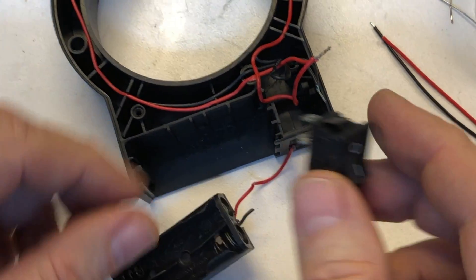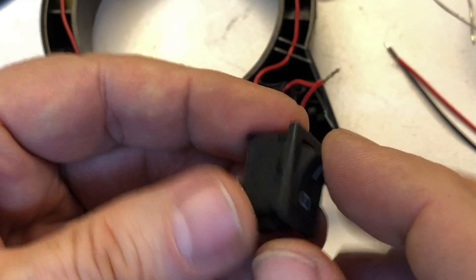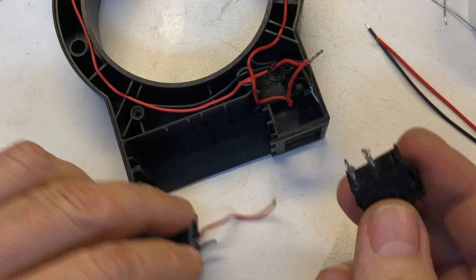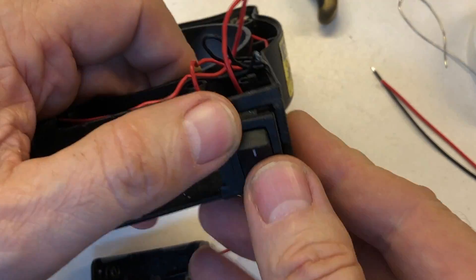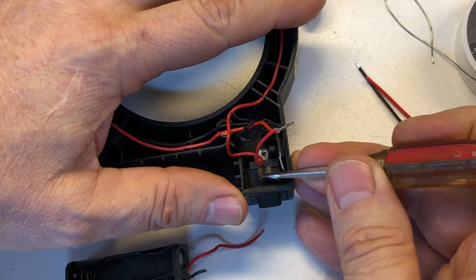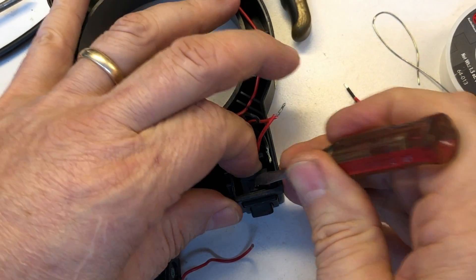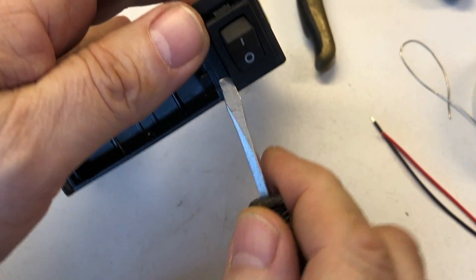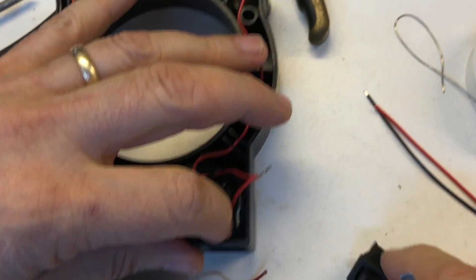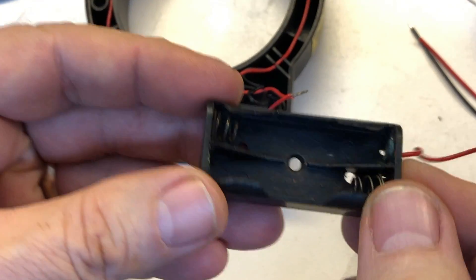In popping the switch out I found it also had corrosion wicked inside of it. I got an ohmmeter out and the switch is dead too — so that can happen. Let me show you this piece. To get this switch out, get a flathead screwdriver and press down on the tab on the top until it comes out partway, then use the same screwdriver on the bottom to snap it out.